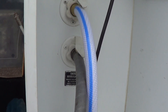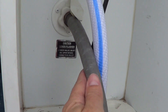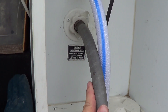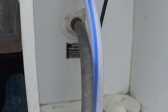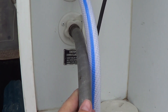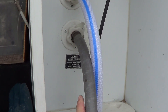Our Cougar has a built-in tank flusher for the black tank. You notice the fresh water input and underneath there we've got a sewer flusher. So we just hook up a hose to that, turn on the pressure and it flushes the tank out. Unfortunately after the last trip down south I noticed my tank flusher is no longer working. I turn on the pressure and nothing happens, so somewhere along in there the line is plugged. That's today's task — figure out where it's plugged and rectify the situation.